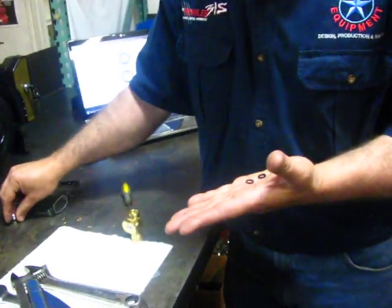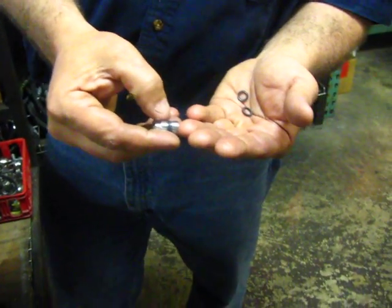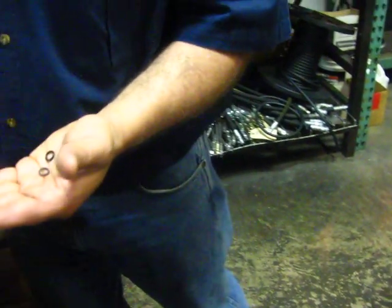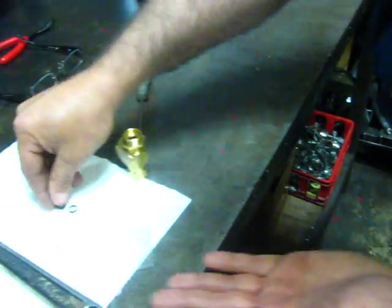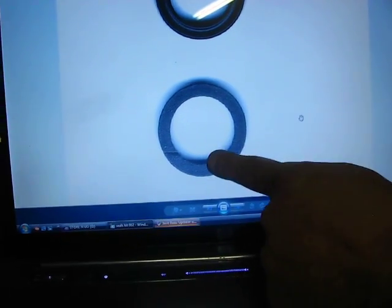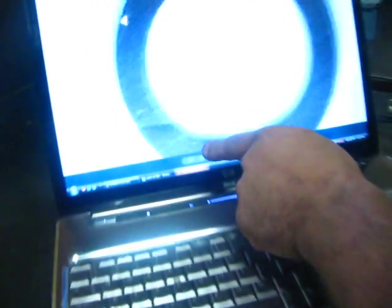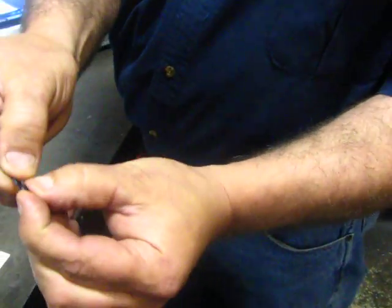The problem is the piston. As far as replacing the piston seals, you remove these two seals. Once you get the piston out, you'll be able to see smears and burn marks on these seals. Simply remove them. I took a picture of them because they are so small you might not be able to see them in my hand — I enlarged them so you can see. This is called a backup seal, which has a hard feeling to it — it's kind of hard to even squeeze. If you notice, there is a cut in it. Because it's a hard seal, you cannot stretch it over to put it on the end, so they have a pre-cut section so you can open it and place it.